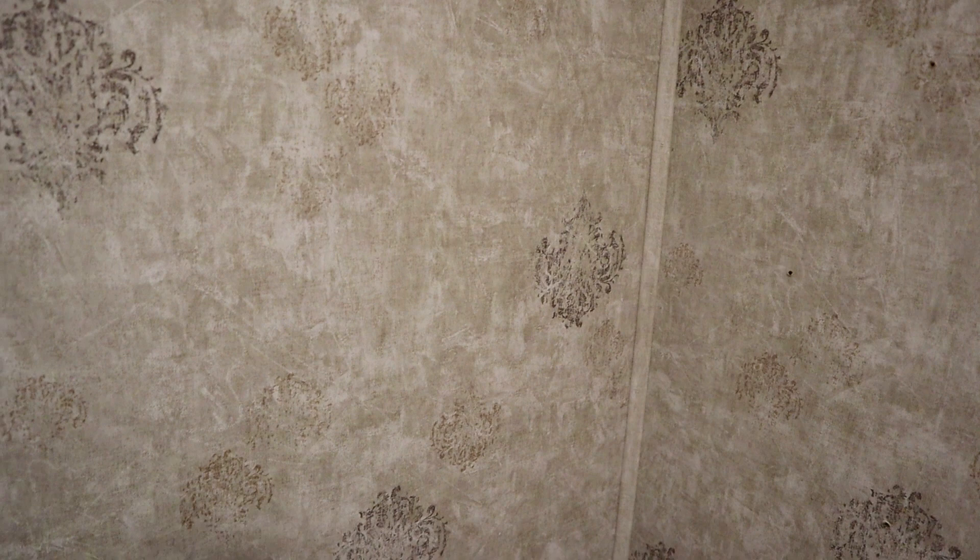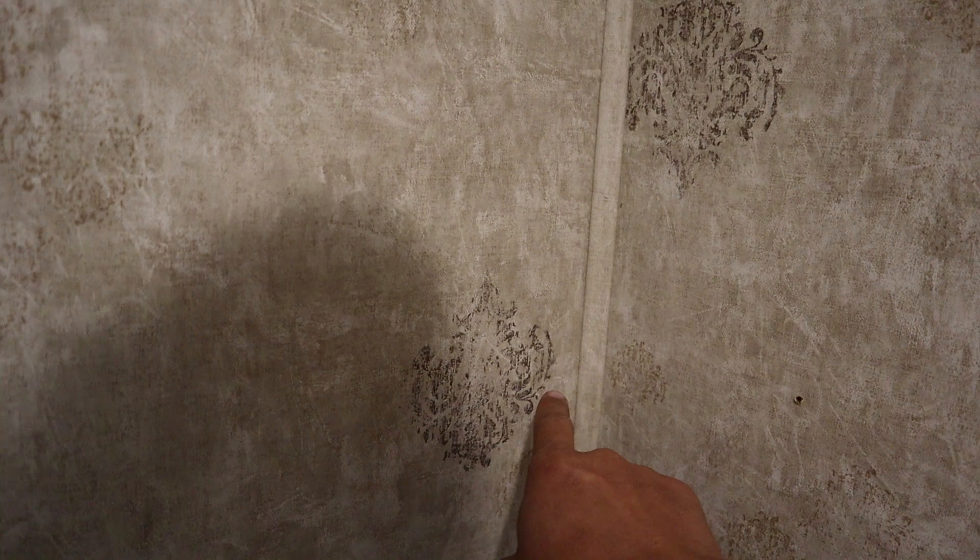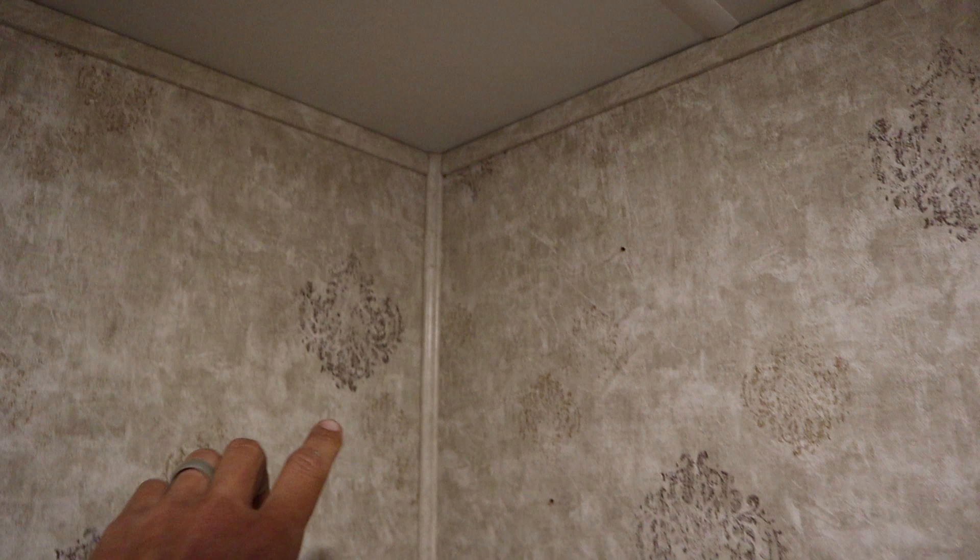These are the walls — they're kind of textured walls, I call them hospital walls because they've got this woven-like texture to them. They're in all RVs and they've all got these busy patterns on them. What the busy patterns do is break up the seams right here, because when you paint these all one uniform color you will see every crack along this trim work. This stuff does a really good job of camouflaging that. So what we're going to do is fill in all along there with silicone sealant, and that'll close it up and make it look really nice.